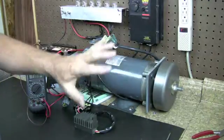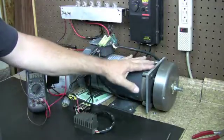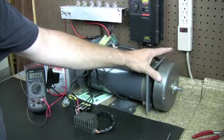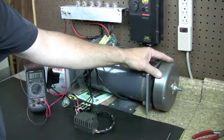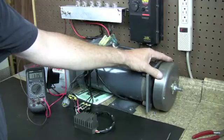That was just a test showing you that's all there is to your motorcycle charging system — a stator and this magnet that spins around. I've never seen one go bad in my lifetime, except in accidents. If you drop your rotor on the floor while working on your bike, it's very possible it'll knock a lot of the magnetism out of it and cause a problem that no one would ever find.